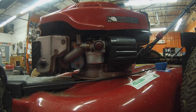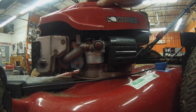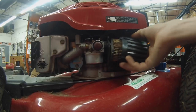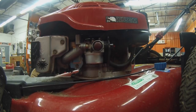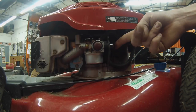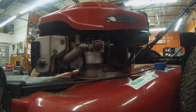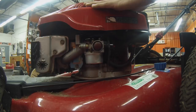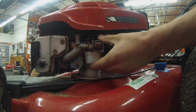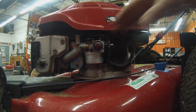The first thing we're going to do on this machine is try and run it. It's not starting under its own power from the carburetor, so we can attempt to start it via the air cleaner by spraying some starter fluid, gasoline, or carburetor cleaner — those are all flammable and okay for test firing. If the motor fires under carburetor cleaner or starter fluid but will not run under its own power, you probably have a fuel system issue — the engine's not getting gas.